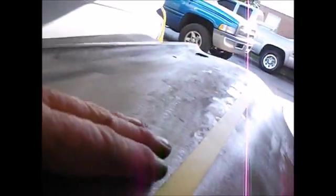Now I'm going to use a dent puller, and I'm going to make sure I don't go on any of the places that I welded because they're probably a little weak. But you can see there's kind of a partial crease. I marked a couple of places where I want to put my dent puller. On this body line, there's one right there I need to get, and one right there, and I probably don't need to get these little ones. But you see that one, you see the crease in it, and it's pretty rough. So I want to work that one out, and this other one too.